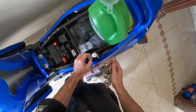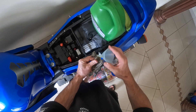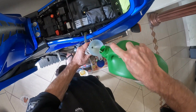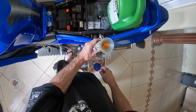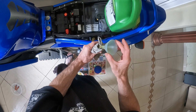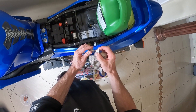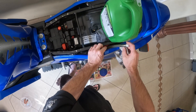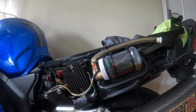The system can actually be filled from the top without removing the back cowl — the tube extends quite far up and can go outside the back so you don't mess inside. The cap gets removed, you put a small funnel on the inside of the tube with a breather to the side, and it fills up the tank without hydraulically locking. When the cap is replaced, the breather tube is open to atmosphere and the filler tube is sealed off.